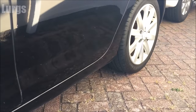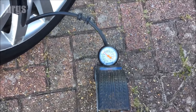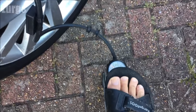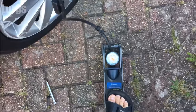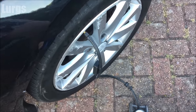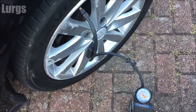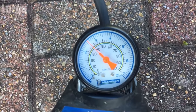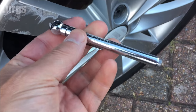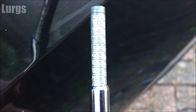On my front driver's side it is a little bit flat, so I'm just going to pump it up old-school with a foot pump and put some air in. I've got a gauge on this foot pump but they're not very accurate, so I've also got a manual gauge. I've pumped up to about 38 — putting in the tire pressure gauge and we're reading 38-39, which is perfect.